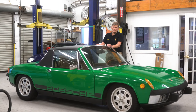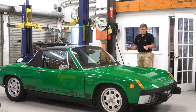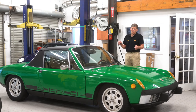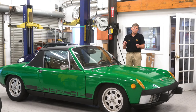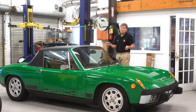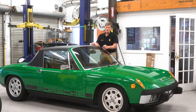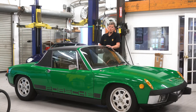The first thing we want to do before actually driving the car is check the tires. 914s have four-wheel independent suspension, and if you have tires that are too wide or not at the right inflation, it'll radically affect the way the car handles. Alignment is critical. These are 195/65-15 on the factory wheel — the widest tire you want on a 5.5 wheel. Any wider, such as a 205-60, the car will wobble in corners as the sidewall flexes. Don't ever put a P-rated passenger tire on your 914; the soft sidewall will flex even more. The car was originally equipped with 165-15 tires, which worked very well on the 5.5 rim.